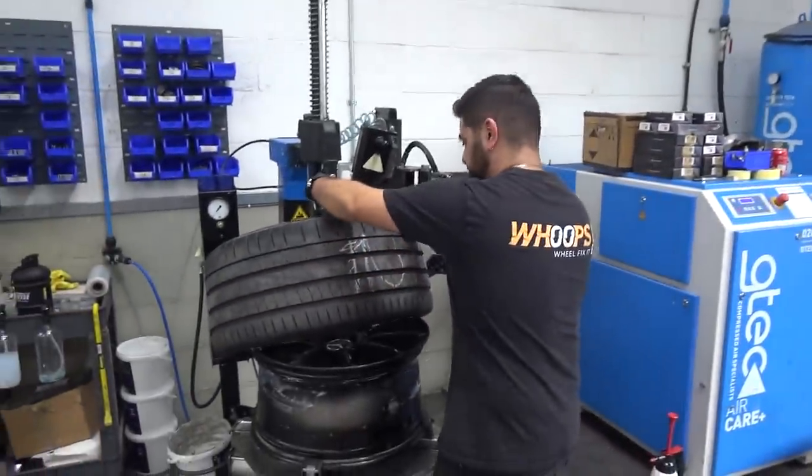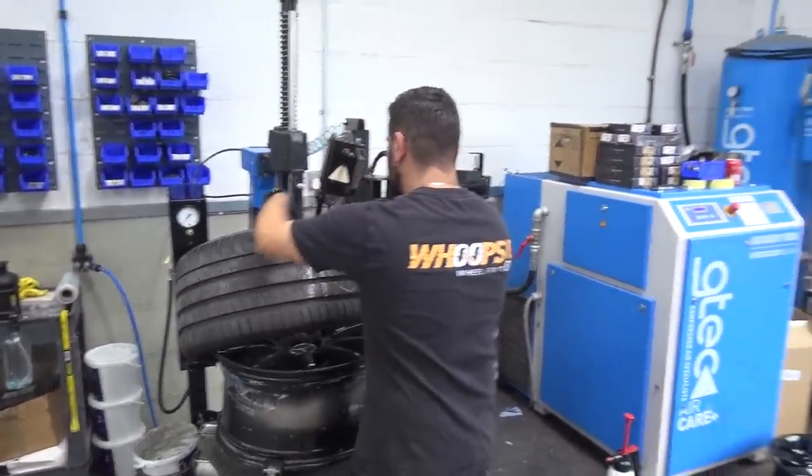If we were to cut them, not only could you not refurb them again, but you'd end up with a visible step between the silver and the black that isn't there from the factory finish. To keep it as OEM as possible, it's best to replicate in paint — and it gives you another chance if you curb them again. So we're going to get the tyres off and follow the full process. The first stage is getting the tyres off before the wheels are washed in an acid mix, then heading into the alkaline strip tank.